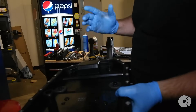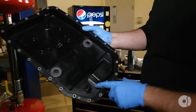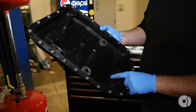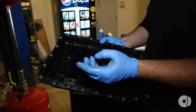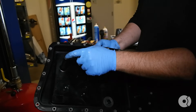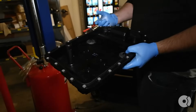This is the new filter pan assembly we're using. We're installing one directly from ZF and as you can see, it's manufactured by Filtran. This is the OE one that your dealer would sell you and this is the one I personally recommend using — I've seen some aftermarket ones have fitment issues, particularly here. This seal absolutely needs to seal; basically this is for the oil pump. If this doesn't seal properly, you're going to have all sorts of oil pressure issues in the transmission, it won't shift properly, and you'll have other performance problems.